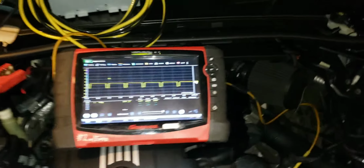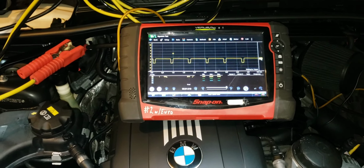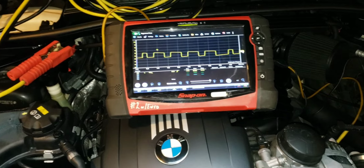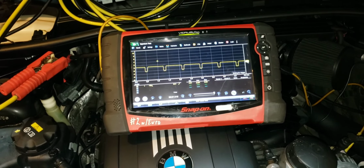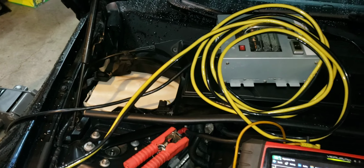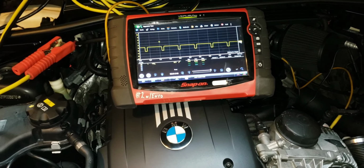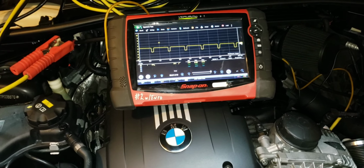I have not seen a good BSD circuit diagnostic video. It's very straightforward if you know what you're doing and what you're looking for. If I disconnected each one of those sensors or connectors, you know, alternator, oil level, coolant pump, and that communication line still did not come back online, then more than likely the DME under that white cover there is faulty. I believe they can be fixed. You could send them off to companies, or you can get a used DME. And if you know someone with the correct tools, change the ISN, which I can do as well.